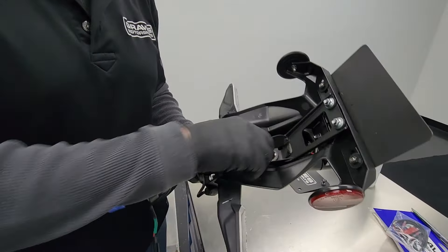Just to make sure you've got your wires set up correctly before you seal them up, we're going to run this thing through and just twist them together, plug it in, and make sure it works before we actually seal the wires to the connector. So I'm just going to run these license plate light wires through the little hole. A lot of guys just leave the light out — you have pretty good light from the tail light on your license plate — but it depends on what state you live in. It's got double-sided tape and it sticks right here. It's nice and tidy, and figure your license plate is going to be lined up here, just put it a little bit higher in case you have a license plate frame.